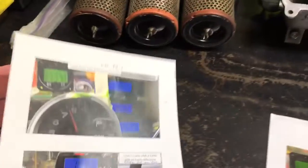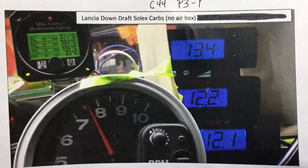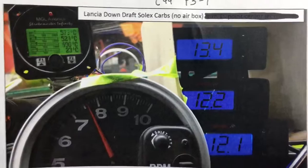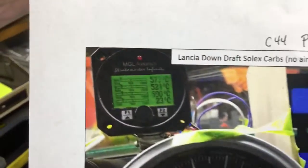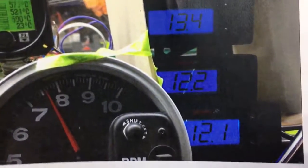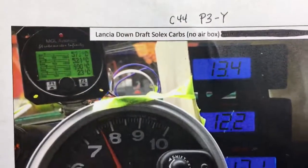When I do that, I can produce tests — probably the most significant testing done on triple Saab triple carbs since Saab invented them. I think the equipment I'm using is superior to what they had back in the day. I've got EGT gauges on all three cylinders and then triple air-fuel ratios. This is a picture of a Lancia carburetor.